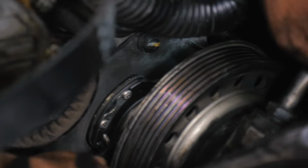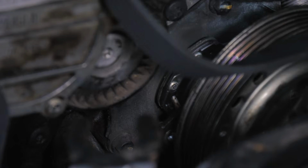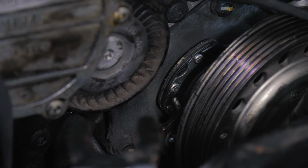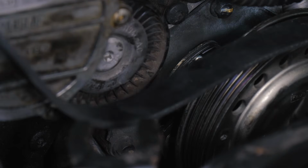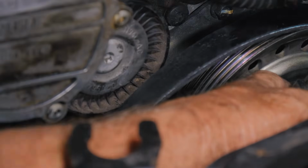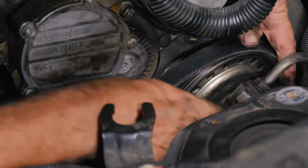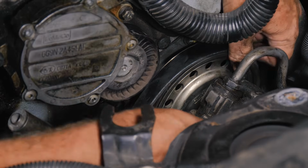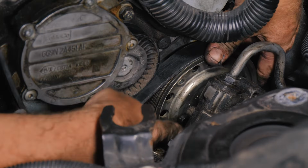Okay. All right, so there you can see we have our pin in. It kind of wobbled as it went in, but it does work its way through. We want to make sure that we have the base of the spring seated to the water pump so that it's not cocked or at any kind of crazy angle, so that our alignment is good. We got the two post pins right here at the base of the pulley.